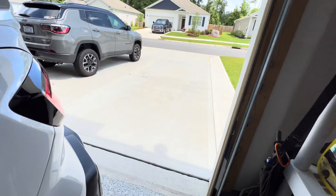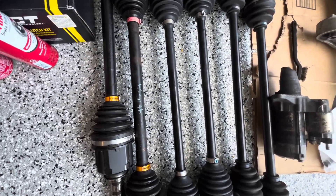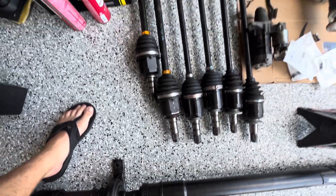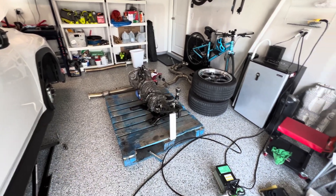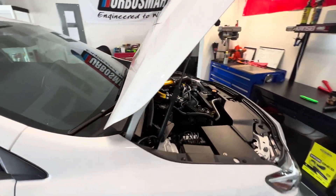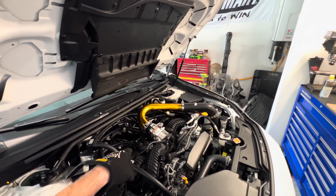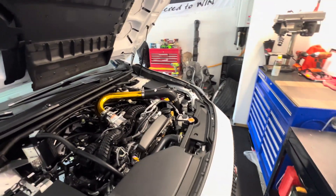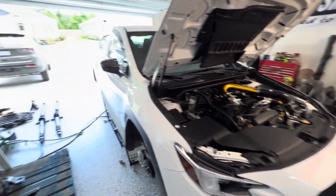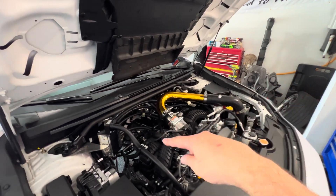We got that axle taken out all the way through the transmission. Looking at all the WRX axles next to the pink STI ones, you can see the STI ones are a little beefier and slightly shorter — not sure if the transmission is wider, we'll compare once the trans is out. Now we're going to start working up top: getting the ETS front mount pipe off, taking the starter out, and the clutch slave out. Before any of that, we're disconnecting the negative terminal since we'll be unplugging the starter.